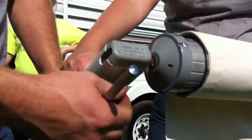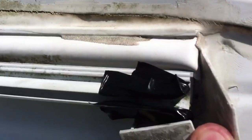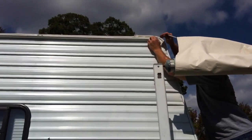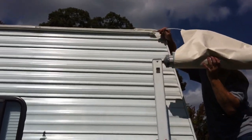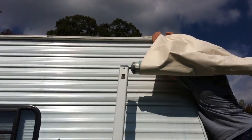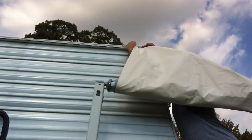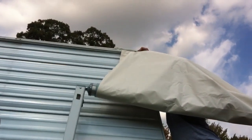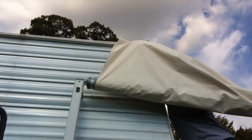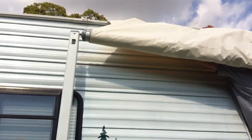Once you get the bolt secured to the rafter rails, it's time to put the new fabric on the RV. I flared out the ends just to make it slide on easier, and I highly recommend putting some electrical tape over the ends so you don't scratch or cut your new fabric. Next, feed the poly cord into the top rail channel — it's best done with someone on a ladder and two people, one on each rafter rail, guiding the fabric along as the person on the ladder feeds the cord into the channel. Just slowly walk the fabric on gently so as not to tear it along the top channel.